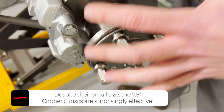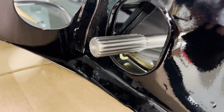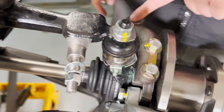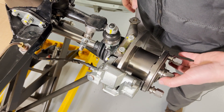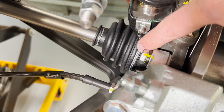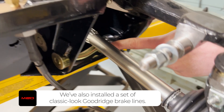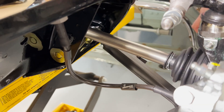We've got the heat treated drive flanges on the end of these seven and a half inch discs, and we've also gone a bit posh - we've gone for brand new 300M MED drive shafts. These are the Hardy Spicer type with brand new CV joints in there. We did go to Mini Spares for the brand new hubs, again just so that we can keep the originals all in one place. Steering arms are Cooper S type, all new top arms. Steve's put all this together and he's actually put lock wire around there which is quite neat. We've got the MED tie rods that we showed you previously - they're rose jointed at the end, solid mounted, fully adjustable - and then the adjustable lower arms as well, which are again solid mounted. So if you're aiming to get the handling of your Mini as sharp as possible, that's the way to go.